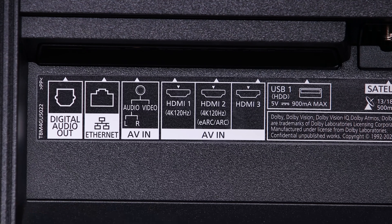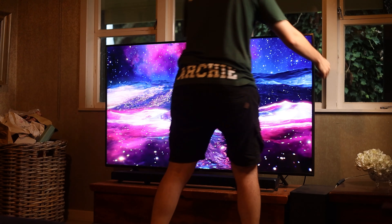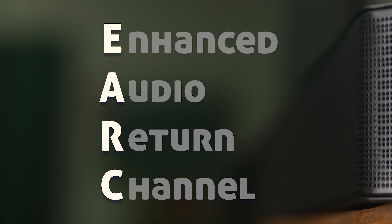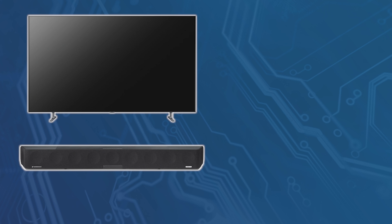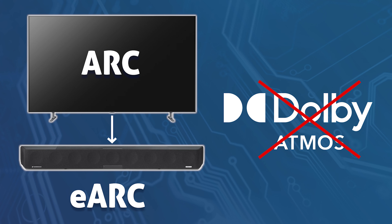To find out if your system can do this, have a look at your soundbar and TV for the label HDMI ARC or HDMI eARC. If both your TV and soundbar have these ports then connect an HDMI cable between them. eARC is the newest version of ARC and allows for more information for Dolby Atmos to be sent from your TV to the soundbar for the best listening experience. They're backwards compatible, so if your soundbar has eARC but your TV only has ARC then it will still work, but the TV will be the limiting factor and you most likely won't get Dolby Atmos. If this is the case and you still want Atmos, then check out this video next.